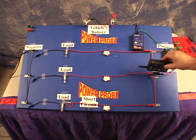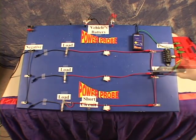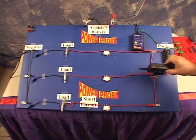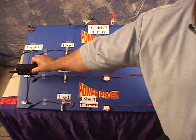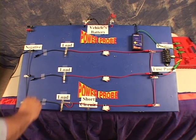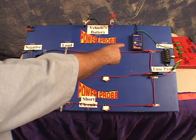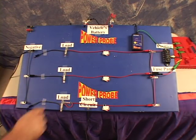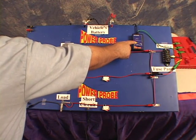Follow the open circuit signal until you lose the signal. We're going to close this switch now. Continue to trace the open circuit signal to find out why it's still open. Here it is. Now let's go ahead and plug in the end of the wire. Now suddenly we're receiving a tone from the smart transmitter. This tells us that our circuit has now made contact with ground. To toggle the tone off, just press the tone on-off button.